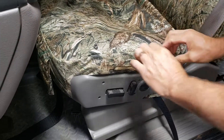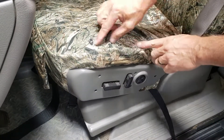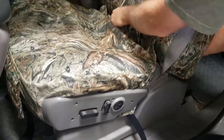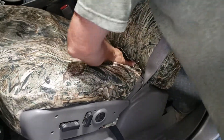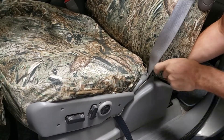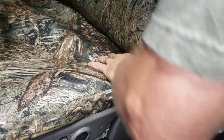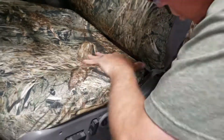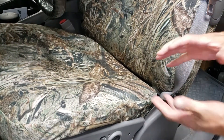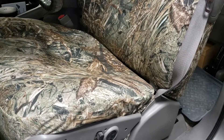Work the material from where the seat cover is sewn together from this side to this side, going to the outside of the round. Tuck the back edge in and leave it curled up so it won't stick as you poke it through. Get the seat cover around the corner of that piece that's sticking out and pull it down. On this model, the driver's seat is often a little flattened from use, so cheat the cover toward the inside and pull it tight that way.